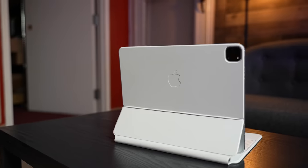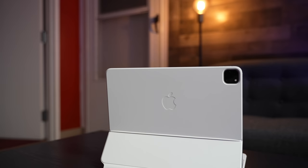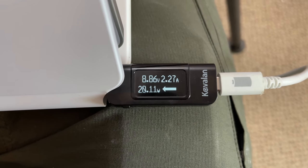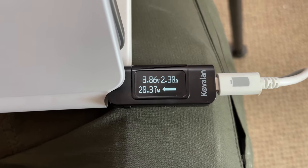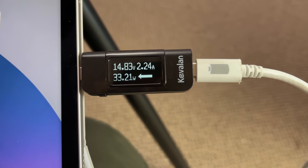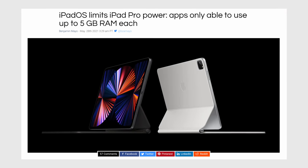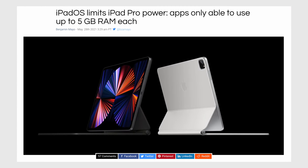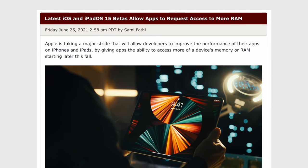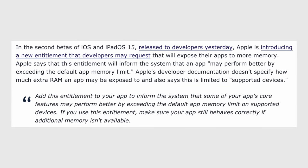Let's finish off with a little bonus tidbit that's going to be extremely useful for all of you who own a Magic Keyboard case. Using a wattage meter, we found that charging the iPad Pro through the Magic Keyboard case's USB-C port limits it to only 20W of charging power, compared to up to 33.6W through the main port, so that's definitely something to keep in mind if you want the fastest charging possible. Also, Apple finally fixed the issue with apps only being able to use up to 5GB of RAM, even on an M1 iPad Pro with 16GB of RAM, so it looks like Apple is starting to listen to all of the complaints.